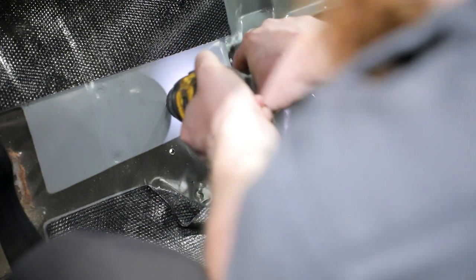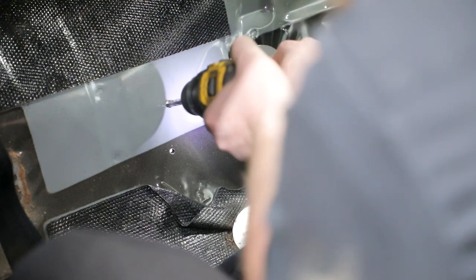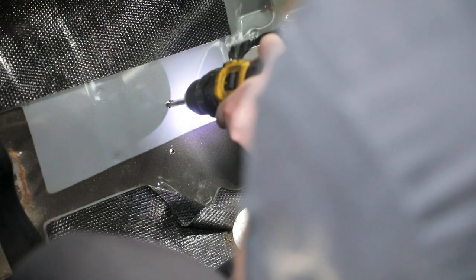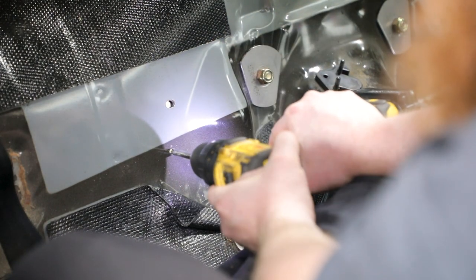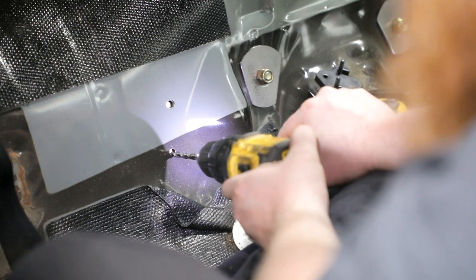If the pilot holes do not look lined up, gradually step up to a 5/16 drill size while correcting the hole location so it lines up with the 5/16 holes in the upper link assembly. It is recommended that pilot holes be drilled first before stepping up to the 5/16 final drill size.